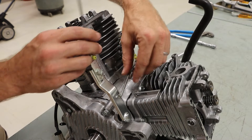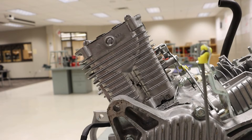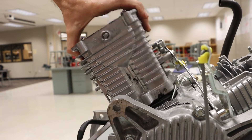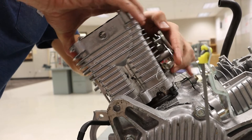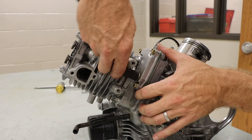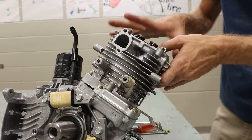On one of those cylinder assemblies we do have just a little bit of linkage that needs to be disassembled, and using a large standard head screwdriver we can work that cylinder assembly free. We can remove that air line to get it out of the way. This procedure is repeated for the other side — first removing all of our nuts as well as that 10mm bolt.